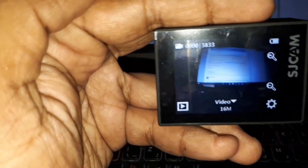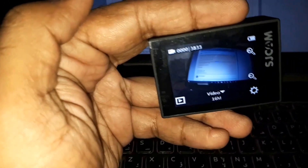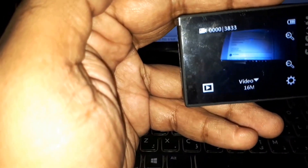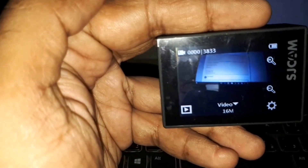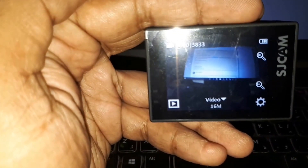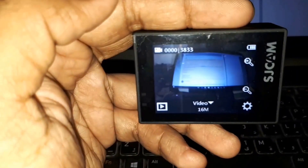The main thing to note about why it might not work — for me and possibly for others — is that you have to rename the file from SJCAM.bin to SJCAM001.bin. Keep both the SJCAM file and the loader file on the memory card at the same time, insert the card into the SJCAM, then switch on the camera. It was not working before but now it's correctly installed. Thanks guys, keep sharing.